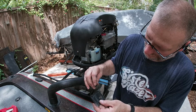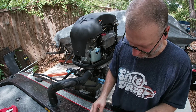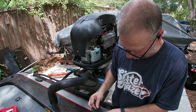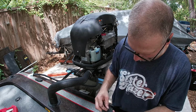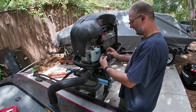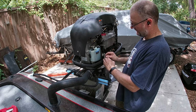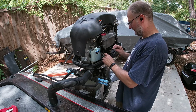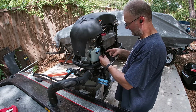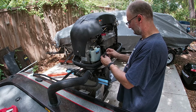So, with that being said, I'm gonna make sure I got my diaphragm in the correct orientation again. So here it is. This is gonna be in this position here. So this gasket will be this direction, right? I'm gonna put it back in the hole here. You can see that hole right there, which is a recess that's cast into it. And these are my two pieces. So if you'll notice, there's an arrow pointing. That's the direction your gaskets will go also.